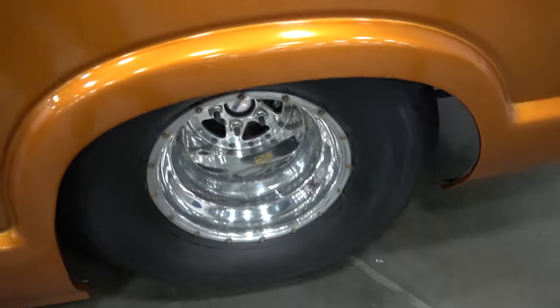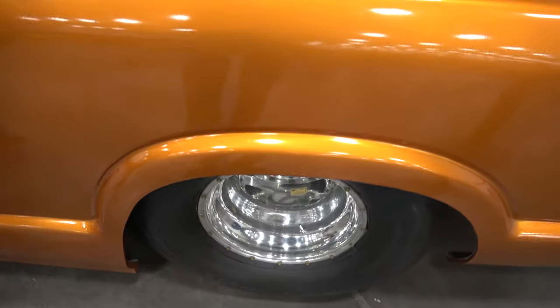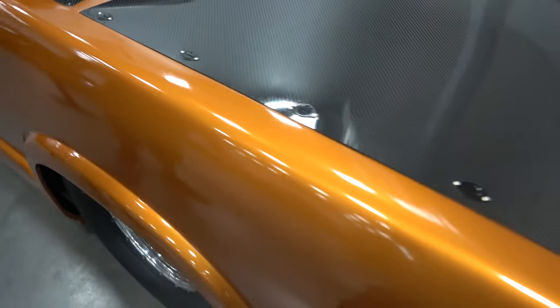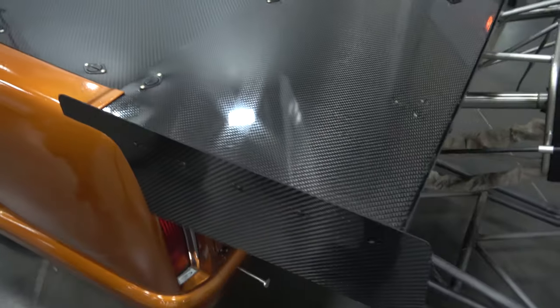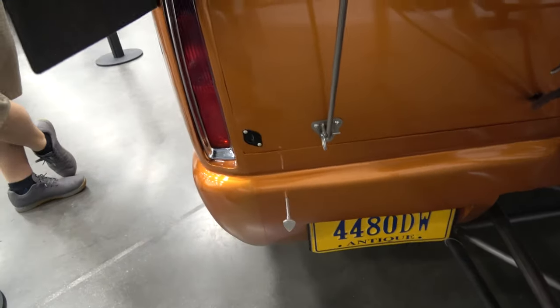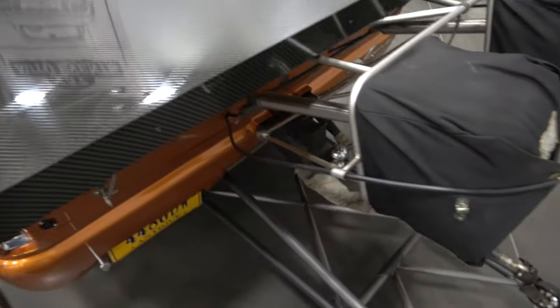Size tires? It is a 33-17.5-15, and it's set up to go even bigger than that. How about your gear ratio? It is a 4.08. It's a Quarter Max sheet metal fabricated 9-inch housing with a 9.5-inch ring gear from Mark Williams. Strange 40 spline gun drilled axles.